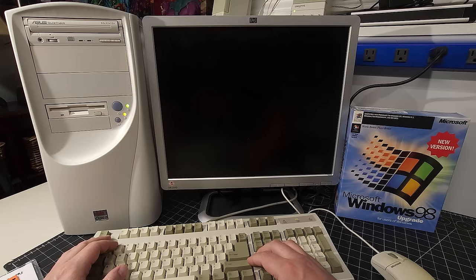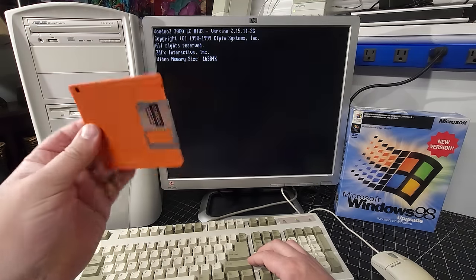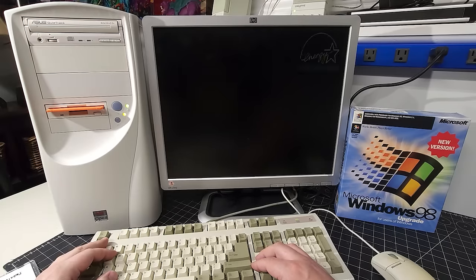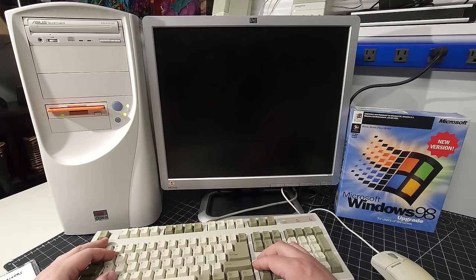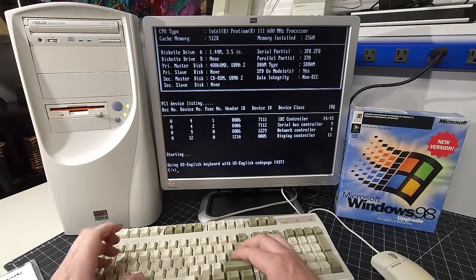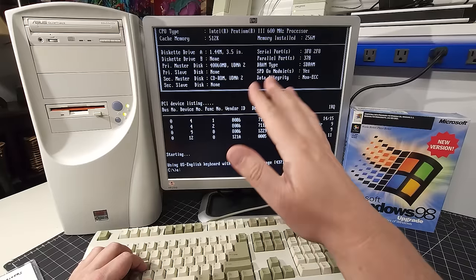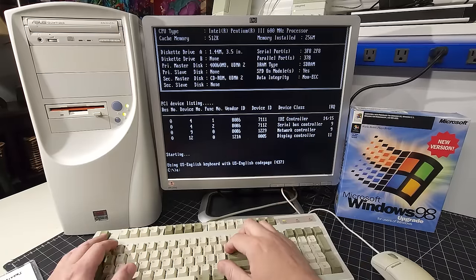Now, speaking of the BIOS, the version is 1006. I do have the latest version here, 1008, and I am going to do an update of this BIOS. That's something that you do at your own discretion. I did go online and check the Asus website, and this is the latest version that is supported by them. Before I move forward, I do have the 40 gig drive already pre-formatted and all that fun stuff, and it is detecting it correctly in the system.